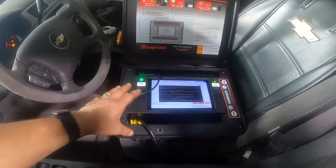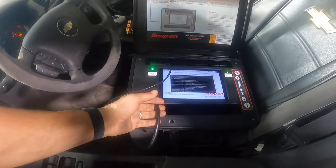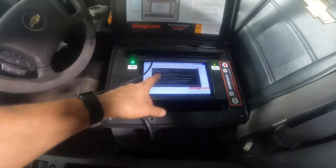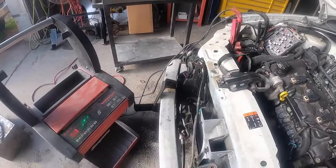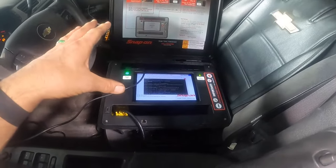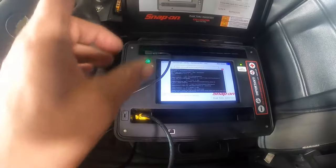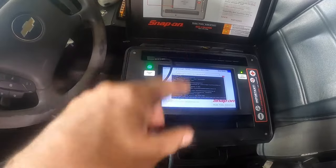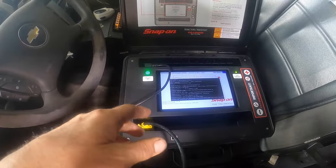Let me show you how this works. We called up and got an 11 o'clock appointment. This is hooked to a power supply — 120 volts — and this is hooked to your OBD2. You have to hook it up about 30 minutes prior; it does a log-in that takes about 15 to 20 minutes. Then they want you to put a battery charger on it to keep the battery up while they do it. It's wireless, so about 11 o'clock they automatically log into it, call us up, ask us to cycle the key a couple of times, and we'll start the procedure. Guys, that's the best money I ever spent — I will not be visiting any more dealerships and getting ripped off for programming. As soon as they're done, we'll finish running the rest of our tests, make sure it starts up, and this job is done.